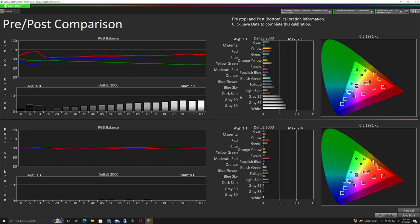We click Next and move on. Now we can see our pre-calibration and post-calibration differences. We were really close before in our patches, just got a little bit tighter in our reds, greens, and edge of gamut performance. But look at the major differences in our shadow to highlight RGB balance — how significantly far off we were before, and now we're almost zero. This is really good performance and shows we have a well-calibrated monitor that falls well below our maximums. We click Save to save that data for future reference.